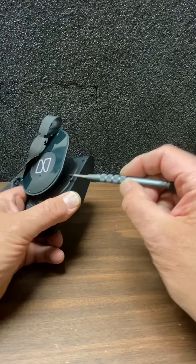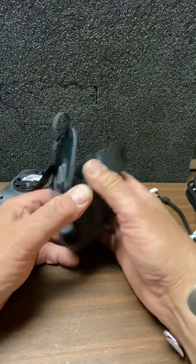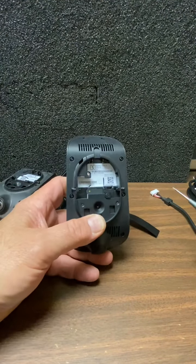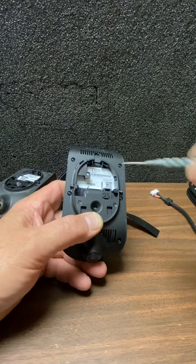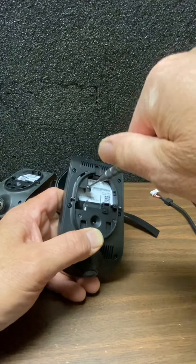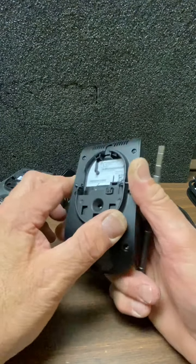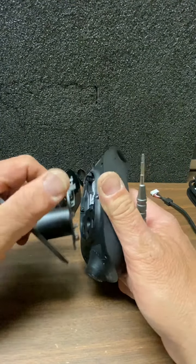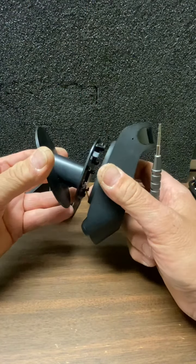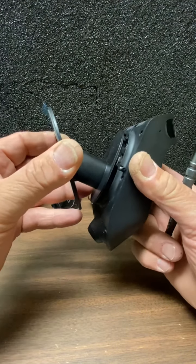Something you need to know: if you come into a vehicle that has an N2 camera and an N2 bracket already on the windshield, you don't want to spend all that time and possibly break the glass pulling the old one off. What you can do — and we did a video on this on the YouTube channel — is remove one T5 screw and the whole insert piece comes out. This whole thing will still mount on the old-style N2 bracket using a bayonet mount. It will be on the glass, and you mount to it slightly by going a little bit below and letting it lock in.